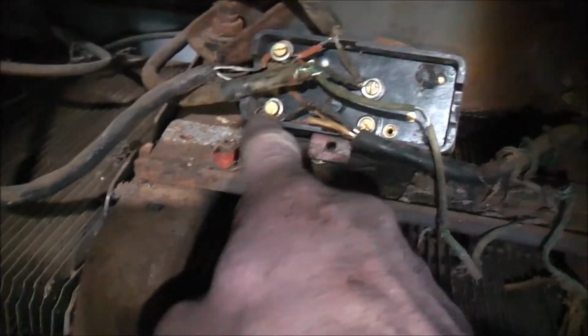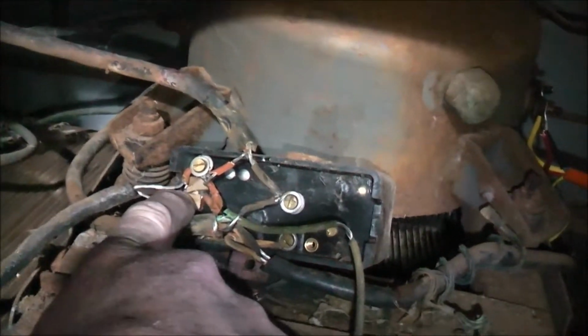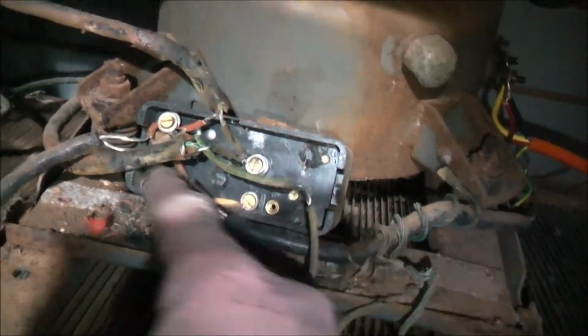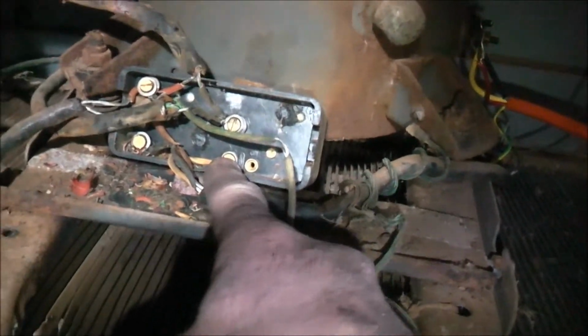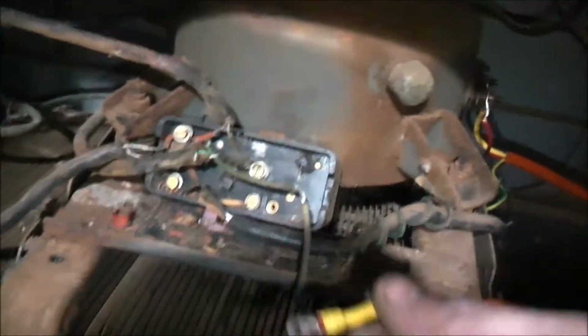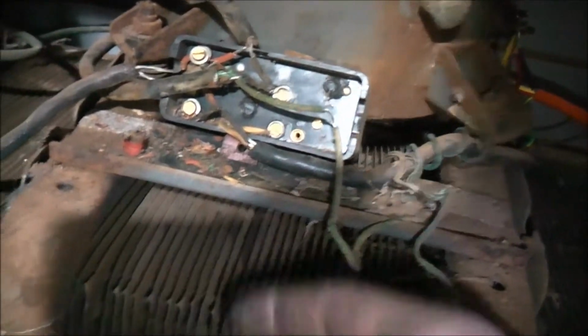We've got a black neutral. And underneath here, this covered terminal is our compressor active start. The yellow goes here. Active is your run. Red's run. The yellow will be your start here. That's your start. Colour coded on this end too. And the black neutral here.